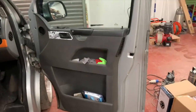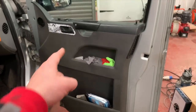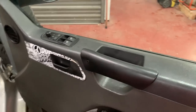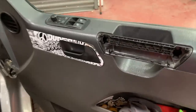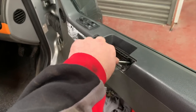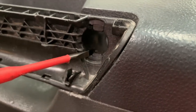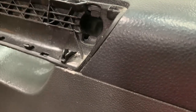I've noticed on YouTube there's no actual videos about how you change this, so I'm going to do a full walkthrough. First thing we want to do is take off the door trim. I need to take off this handle here — it normally just clips off, but I've put a little screw in mine because it kept falling off. Inside there we've got two screws. I'm filming on my phone so it might be a bit difficult at times. Once you've got those screws undone, get a screwdriver in and prise up the little tabs so it unclips.